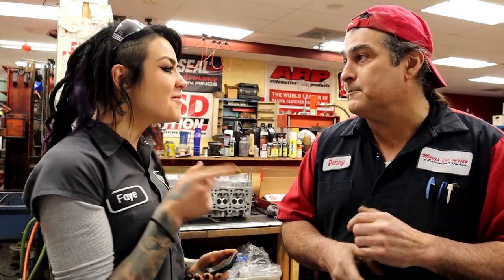Danny said he grew up welding aluminum and taught himself how to do this. His buddy said it doesn't matter — you softened it, it'll never hold the head gasket, and you're doing a blown big block, even worse. Well, we welded the head from one side to the other, the crank was bent because the block had a hole in it — it chunked the rod out the side. We straightened the crankshaft, welded cast iron on the side of the block, welded the head from one side to the other. Three years later — still running.